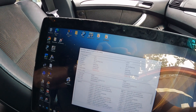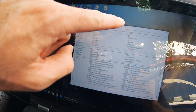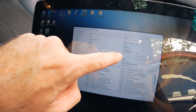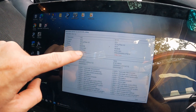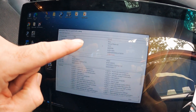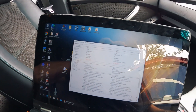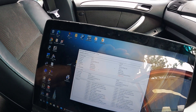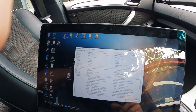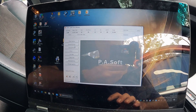As I mentioned earlier, the mileage is stored in the IKE, the EWS which is pretty much just the DME — and interestingly it looks like the DME has stopped counting since we changed the light control module, because we've done about that difference in mileage since it got driven to Queensland Raceway. We might need to line these up as well. So we have BMW Scanner connected and we need to go Select, close that, then go Units and go LCM because that's the one we want to work with.